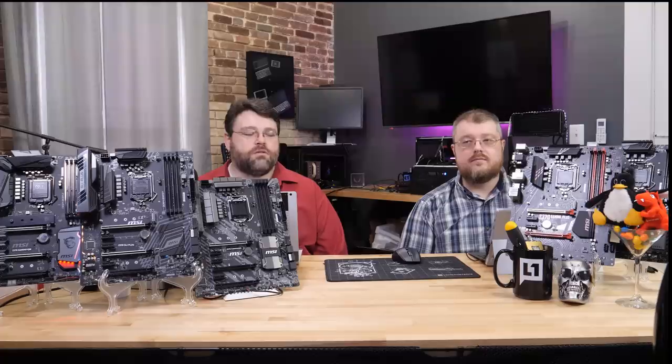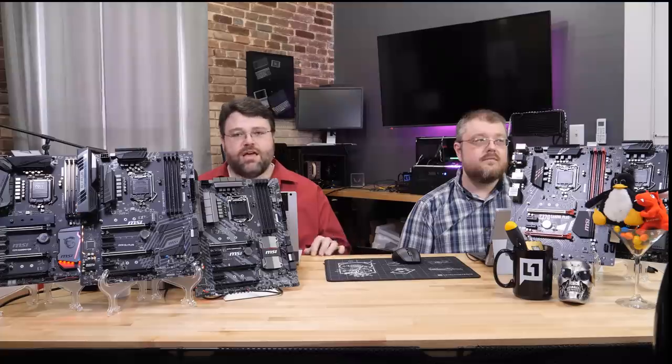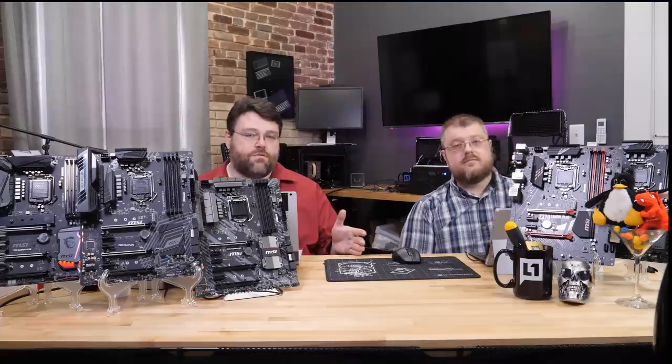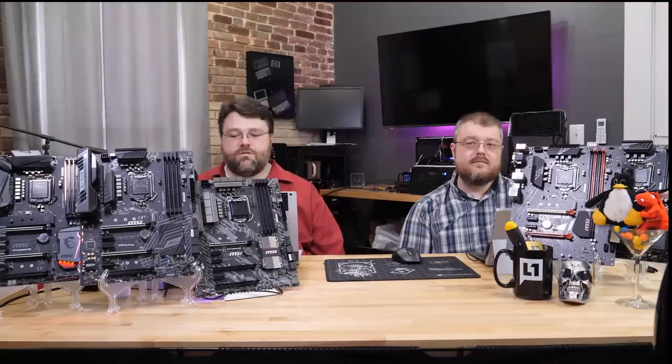I think most people, when you're getting the CPU and you want to overclock it, don't start by feeding it a ton of voltage at first, because you can probably just very slightly increase, like 0.05, the voltage and get the stability. Especially if you're only going to go for 4.7 or 4.8, it may not even need an increase at all. And so with that, the thermals are actually very good, because the CPU is not getting a ton more voltage than it was rated for.